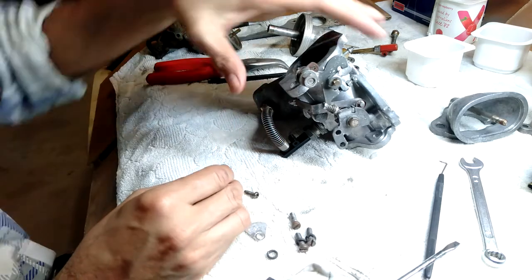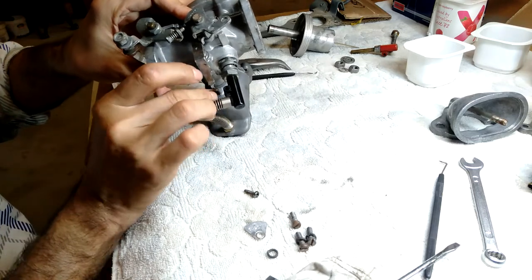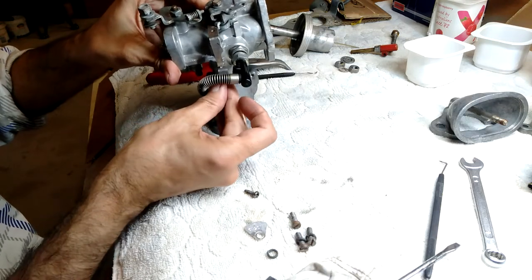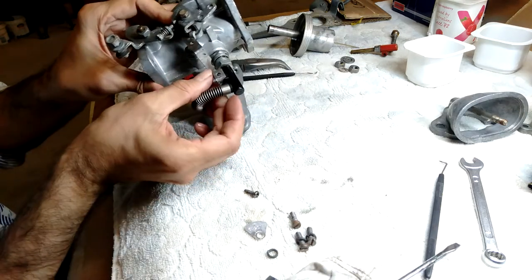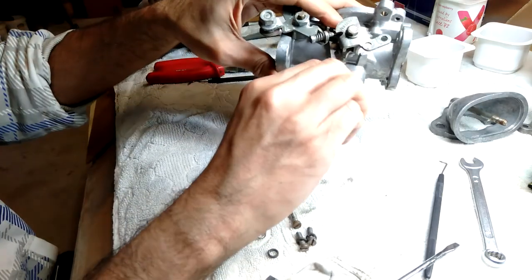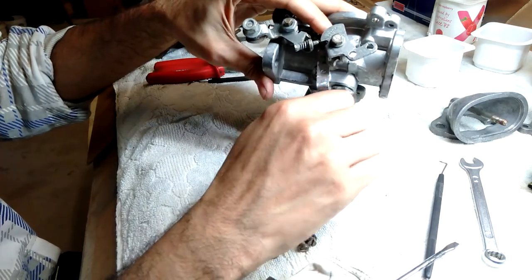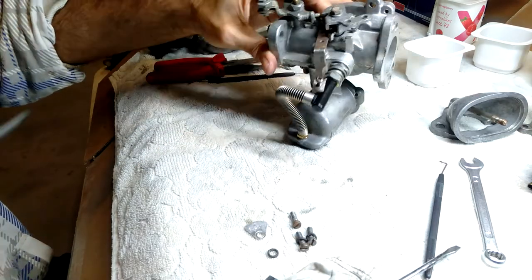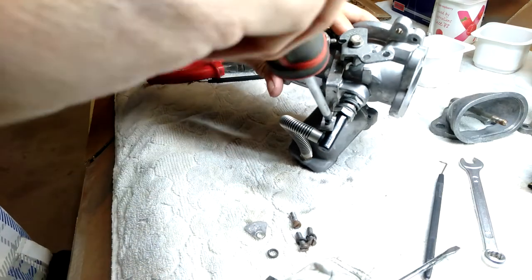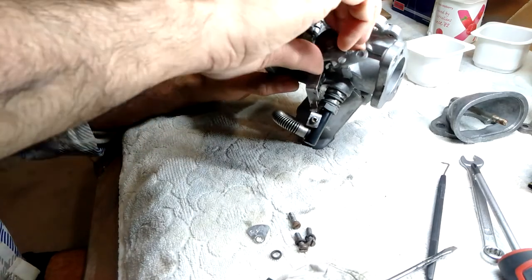We need to give this two rotations. I like to just put a dot on there so I can keep track of the spot, and then rotate it — wind it back down two rotations. That's once, and two — that's the default setting. Now it is ready to have this end inserted in there. Just make sure the hose is fully in there before you tighten it up. That little indentation is for there, and then that goes across to here.